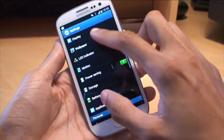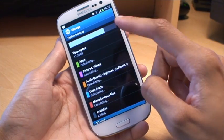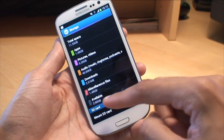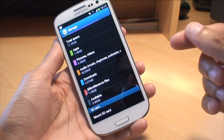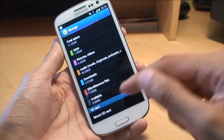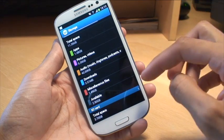Scroll down to where it says storage and you'll see the various storage options for the phone and what it's comprised of. If you scroll down to the bottom, you've got the SD card section there. You can see it says mount SD card — just because you've put the micro SD card in the phone, that doesn't necessarily mean that the phone can automatically talk to it and connect to it. So press mount SD card for it to essentially connect to the SD card.